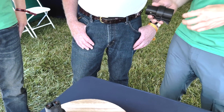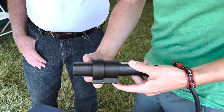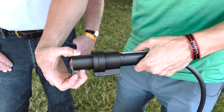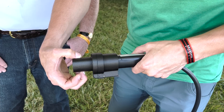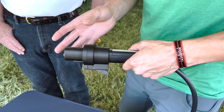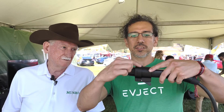Let's go over how it works to show you how simple and clever the idea is. When you have the charging wand, all you do is plug it in to your charging port. The moment you click this, we actually connect the communication ports. Once that happens, the locking pin comes in and holds it in place. If something happens — be it a fire, a bad guy, a moose — all you have to do is click 'unlock charge port' in your car. That releases the communication pins, so the EV does not know you're plugged in. You can then shift into drive and drive away. It's meant to break right here at the seam.